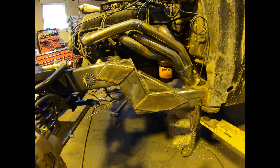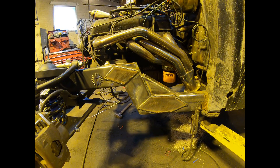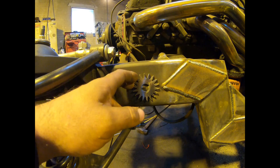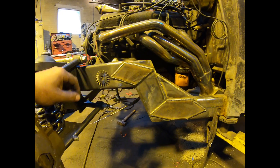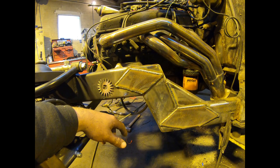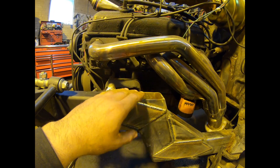Got my diamond-shaped eighth-inch plates welded on the seams on the side of the rail in traditional rat rod style - diamond and weld exposed, not going to grind or buff anything, just give it a wire wheel and hit it with some flat black. Up here I've got one of these stars left that they had on the rail for decoration - took two off already, nothing matched side to side. I'm going to air chisel these off and weld one right in the middle of each diamond-shaped plate since they were on there and maybe he'd like them back. Then I'll cap the top of these tubes - I think it'll look a little better if they're sealed off.